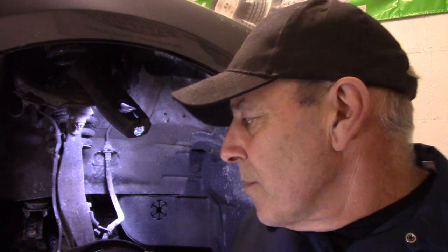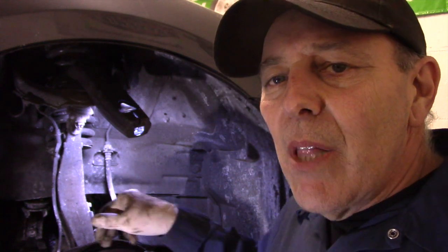And that's it — we're all done. You may notice a little bit of smoking or a burning, oily-type smell — that's perfectly normal because everything is covered in grease. Even though we cleaned it off with brake cleaner, inside the ribs of the rotor you'll still have a little bit of oil in there, so you will get a little bit of smoking. We're going to do the other side, take it for a road test, and out the door.